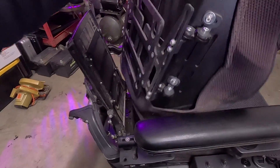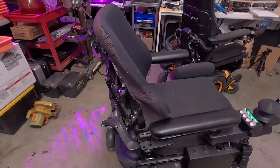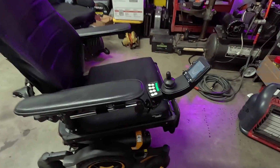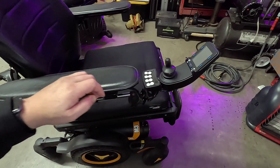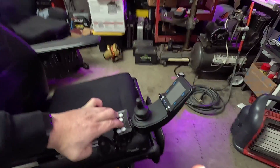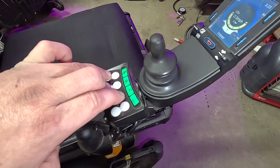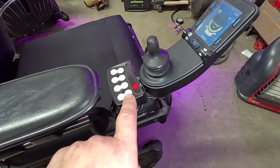Now I can put my backrest back on here — and there we go, it's reattached. Let's go ahead and run the same process again here on our 2018 M3. So we will start with it turned off, then we're going to press buttons 3, 5, and 6 while we turn it on. I'm going to use my pinky on my other hand here to turn this on. Wait till these turn green, let go — we'll get the little flickering, then press button 4 to initiate the process.